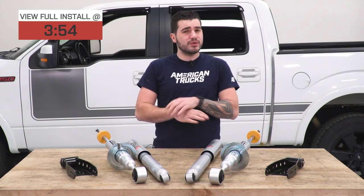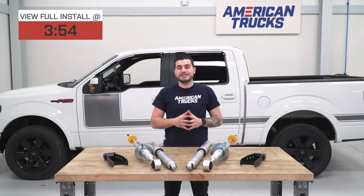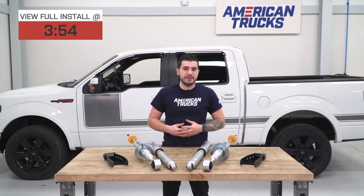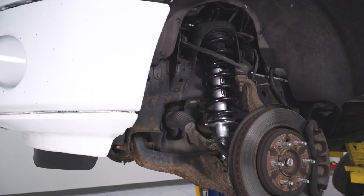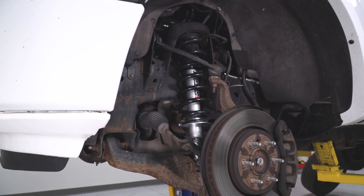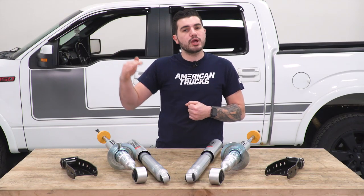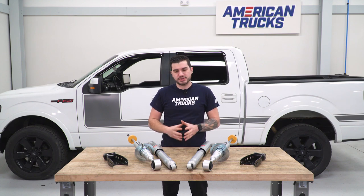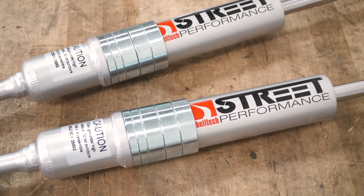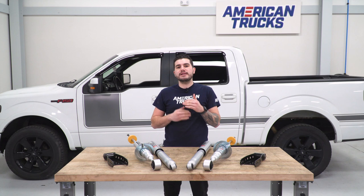This kit is a really affordable way to do things correctly. It has an adjustable front and a solid rear to give you the look you want. You can lower your truck and level it at the same time. This kit has that plus two, minus two front, which basically means the front struts replacing your factory struts are an upgrade in compression and ride quality, and made specifically to handle a two-inch lift or a minus two-inch lowering at the front. The kit uses spacer rings underneath the bottom strut seat — 8-millimeter and 16-millimeter rings to incrementally accomplish the size lift or lower you want.